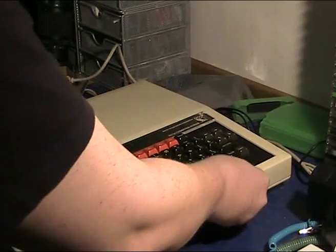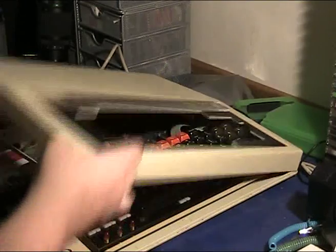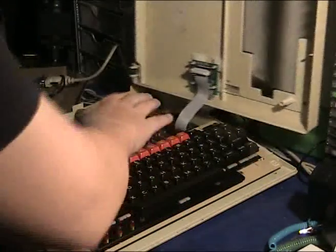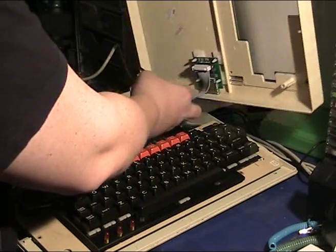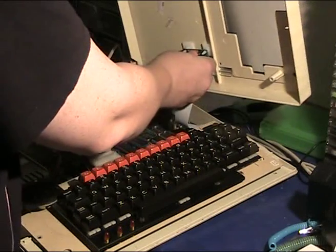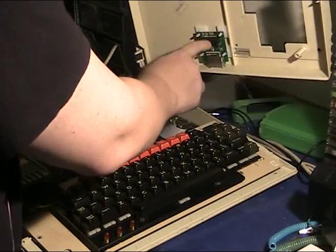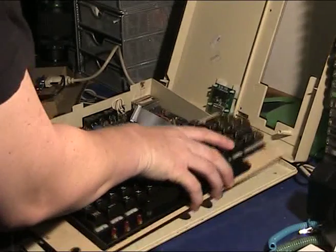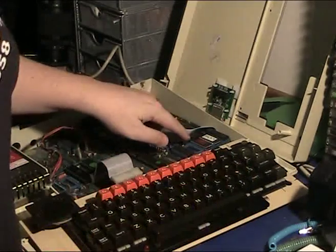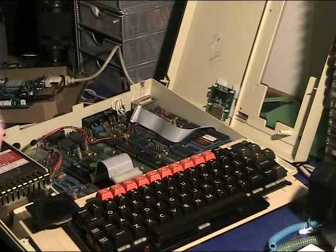I'm going to post a link to the reseller, because you can buy these on eBay. It consists of a basic piece of equipment that converts the MMC card and allows it to go via the user port. The other part is a modified DFS, which is on an EEPROM — just install that in a free slot and you should be pretty much ready to go.